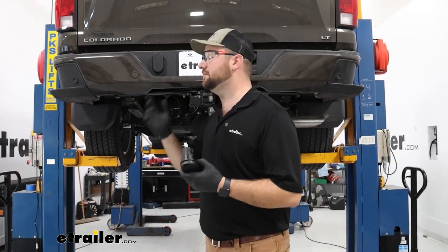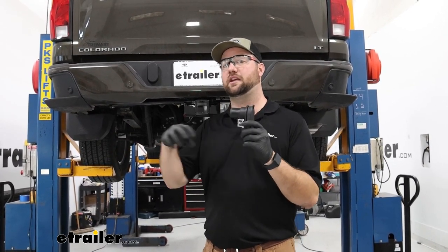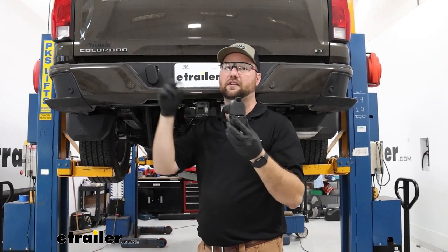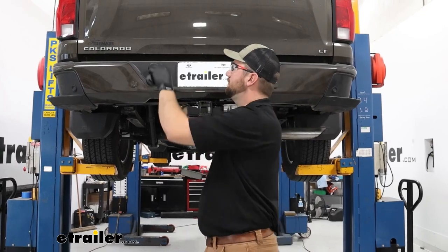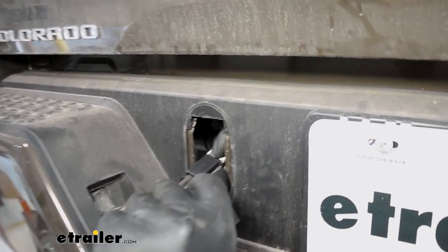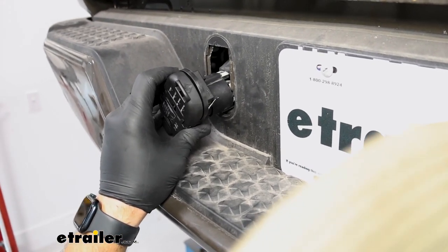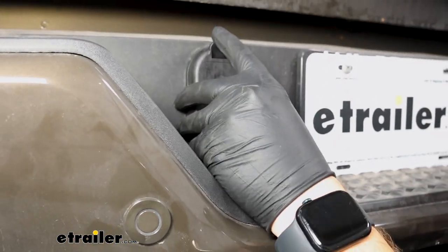To begin our installation, it's going to be one of two ways to install this plug. The plugs are going to be the same, but it's whether or not you need the pigtail. If you don't have a US car connector connected to the back side of this dummy plug, you're going to need this plug with the pigtail on the back to be able to hardwire into the wires. Ours is prepped with the US car connector. Ours is as simple as pulling our wiring out, popping this gray tab back, pushing on this black tab, pulling it out, and then taking our new plug, getting it connected, locking our gray tab open, fishing it up, locking it into place, and you're finished.